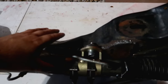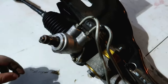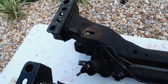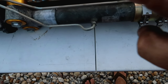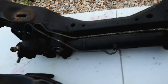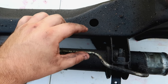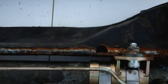We got it to work - Huffman cut the rack, moved it forward, put in new bushings and mounts, and moved the entire rack forward. This is the new one. I'll show you the differences between the old and new rack. When looking from the back of the car toward the front, on the old one the holes on the cross member are about an inch to inch-and-a-half from the edge, with another two-inch gap to the rack itself. On the new one, those same holes are there but the rack is about a half inch from the edge.